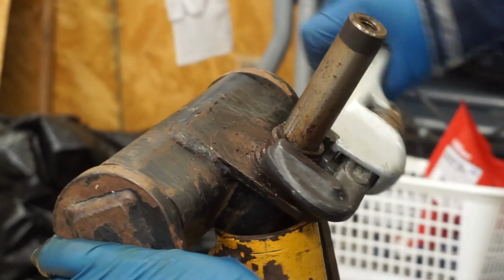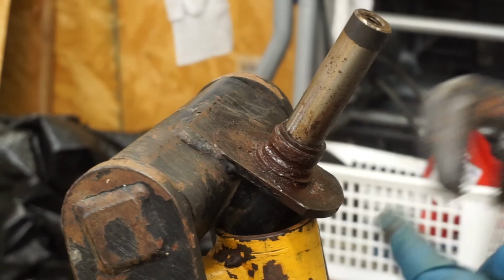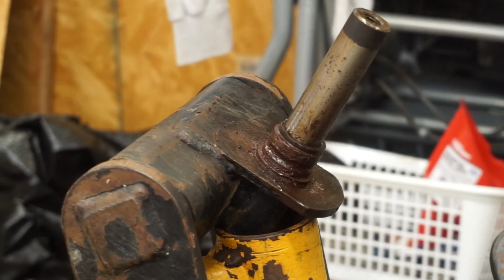And the reason why I'm going to have to put the weld on it is because although the pipe wrench jaws are hardened, you've got to remember how hard these races are. So the two are just going to roll around each other basically like your own bearings. So the next step is clean this up.